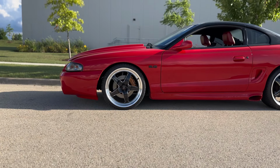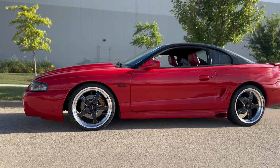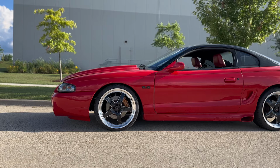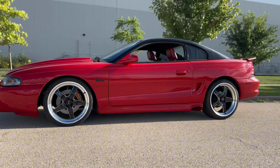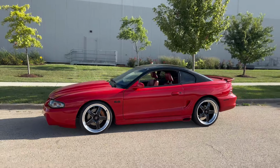I don't see anything underneath, but you know, a small pinhole can cause a drop in pressure. If your radiator isn't making pressure, then your boiling point drops. So let's check under this hood and see if I can find anything. But I definitely can smell it.